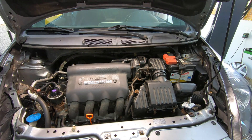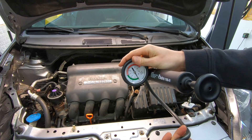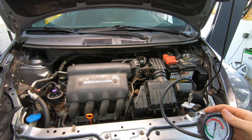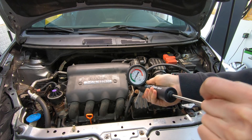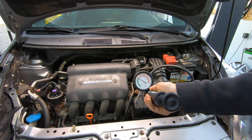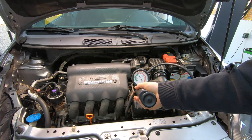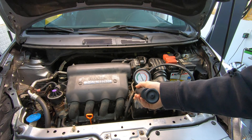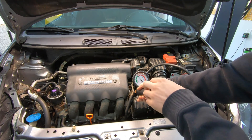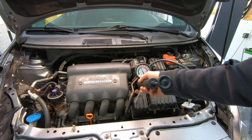Now the other option you have with this kit is a pressure tester. It comes with the vacuum fill and the pressure tester all under one part number for $200, which to me seems reasonable to get both. I'm going to go ahead and pressurize this and make sure it holds. Even if it held vacuum, there's a possibility one of the gaskets could be getting sucked in under vacuum but now getting blown out under pressure, so I like to do both just in case. I'll let that sit, get cleaned up, and then fire the car up.